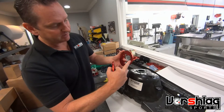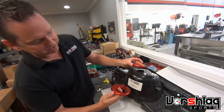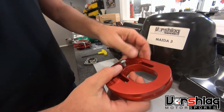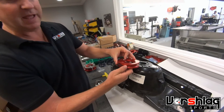This is keyed in place: this corner fits inside that hole, this lines up, and then these bolt together sandwiching the strut tower itself. There's one bolt that goes through the upper plate and lines up with the lower plate, so you line that up in the car, sandwich the tower, and it stays in place.